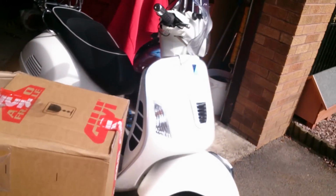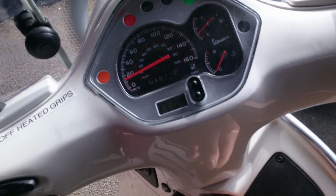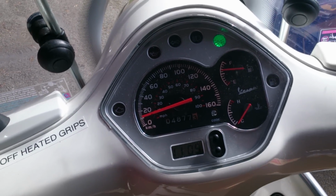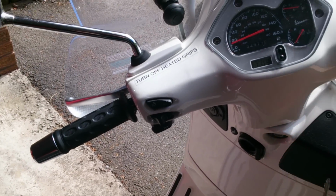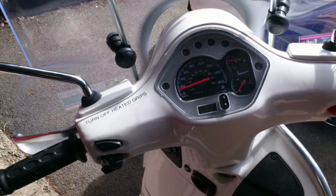Let's go and try again. Hopefully we'll do it this time. There you go, we've now got a key that fits. As you can see, the PATS light's gone out and the scooter starts. Ladies and gentlemen, we've just produced a key from no key by picking the lock, decoding the lock and producing a key. That's got the red data on the key. That's what we can do. Okay, thank you for watching.